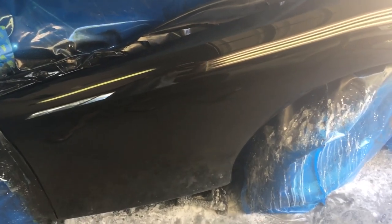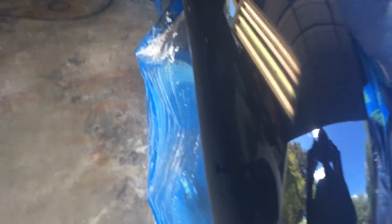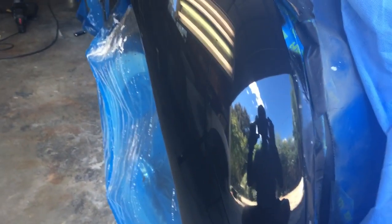I also did the right fender. It had a few flaws in it — nothing much, but something that I knew was there. And since I had to take the front apron off, I might as well have gone ahead and repainted those areas. See the light in the background, how straight that is? That's what your paint should look like — that's flat. I ended up only doing the 1500 grit, and then going back and polishing it with some Meguiar's Black Polish, which is all that I use on my black vehicles. It takes all the swirls out, plus fills any imperfection, little minor scratches, but it's fresh paint, fresh clear coat — wet sanded with 1500 grit, polished.